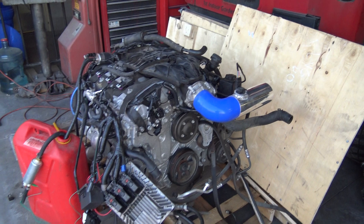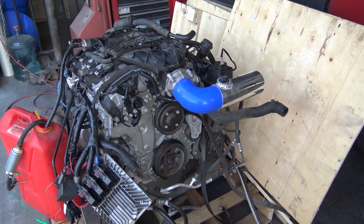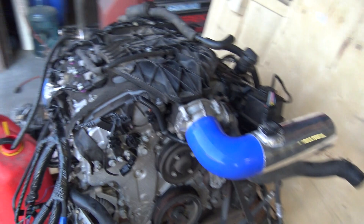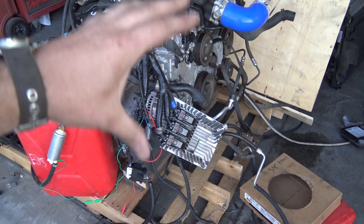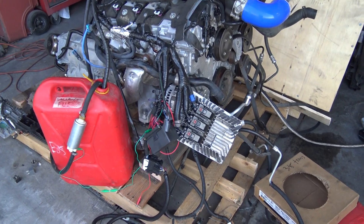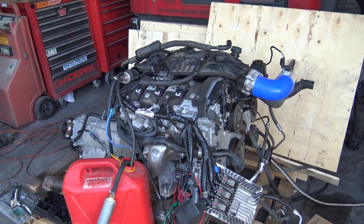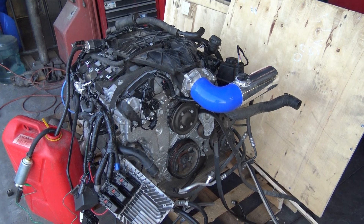The harness wasn't too bad to replace — took about 30 minutes to remove and about the same amount of time to install, just a little more intricate than the standard LS engines. Tomorrow or maybe next week I'll hook up my Camaro gauges to this and make it look nice — put a little stand up here for the gauges — so when I start it up you can see RPM, Prindle, all that stuff. I've been experimenting with plug-and-play packages with a BCM and a gauge cluster setup for Gen 4s and Gen 5s along with the LFX Camaro engines.